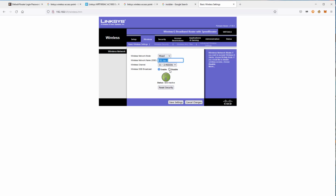connect to wireless. And then last, you want to pick your channel. So whether you're on the 2.4 frequency or the 5 gigahertz frequency, they both have channels. And some of the channels overlap with each other. If you only have one wireless device, it really doesn't matter what channel you pick. If you're going to have more than one wireless access point in your house or your business, then you're really concerned about your channels, because if I'm on channel 1 in a hallway and then down the hallway there's a channel 3, my device is going to see both of those as kind of the same thing. And it's going to kind of timeshare between both of those. So now I'm not time sharing with one device, I'm time sharing with 2 devices, which actually is much slower.